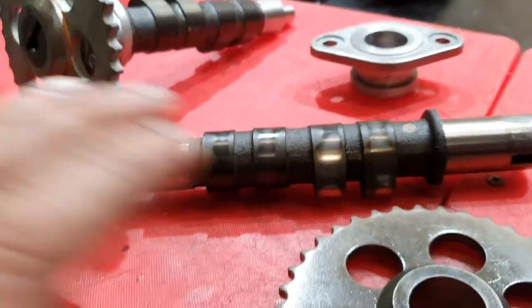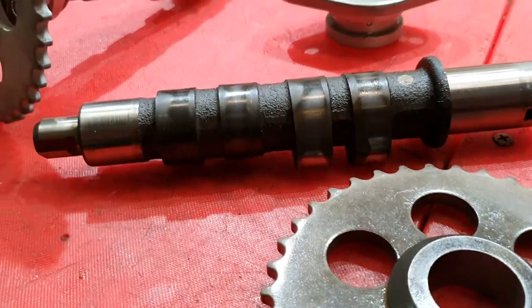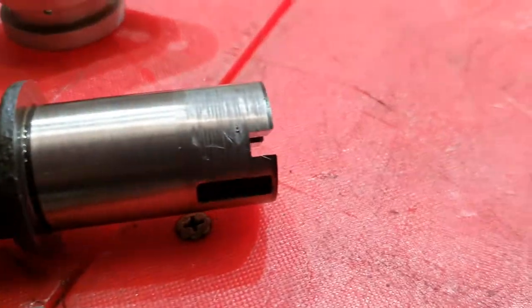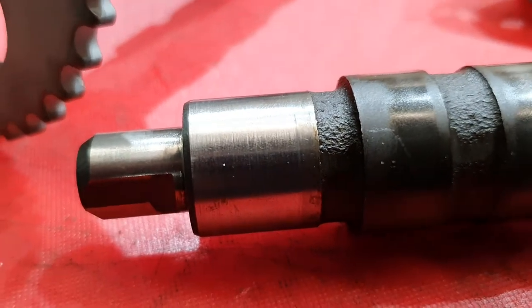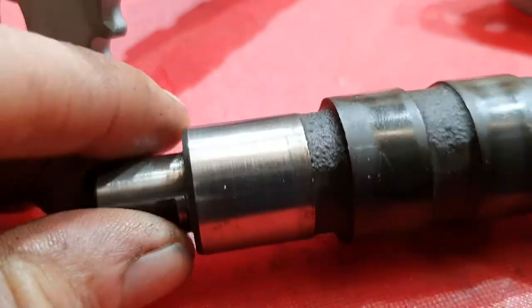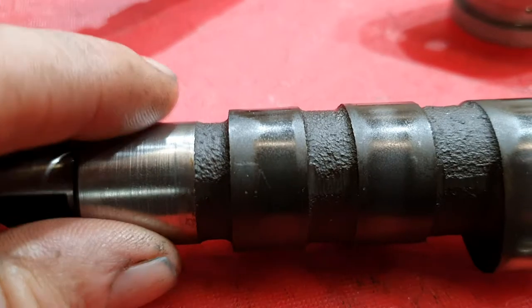When you order a camshaft — this is a late model one — this bit here goes into the back of the oil pump housing, and that flat is what drives the impeller in your oil pump. On the early model ones with points ignition, there's a different end up on the cam that goes into a point, and on that end it has a keyway which goes into a different kind of impeller. This system with the tapered end on the shaft and two flats is actually quite good.